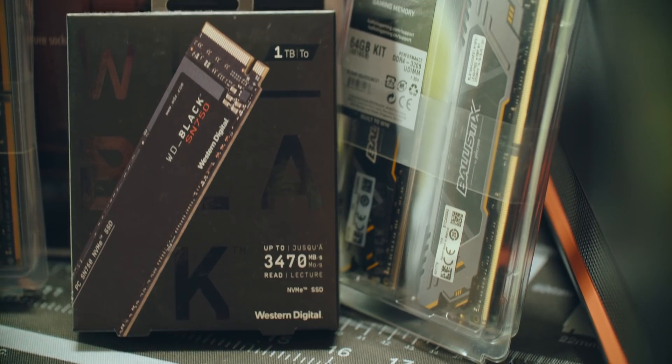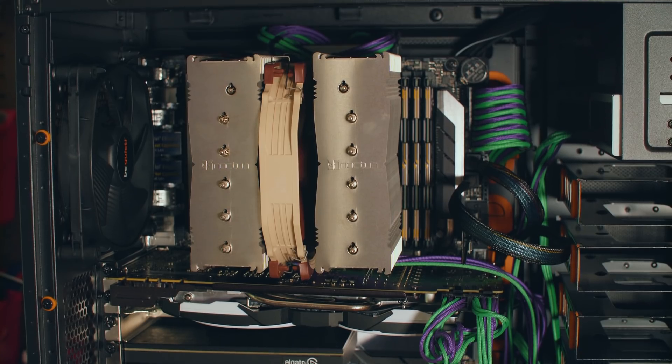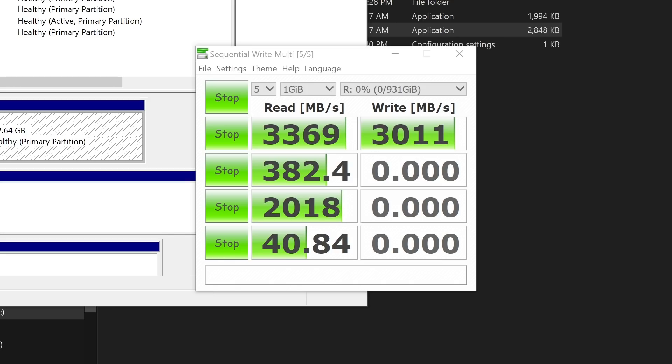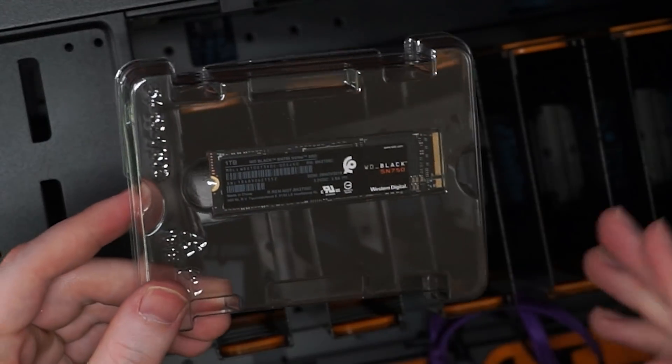Western Digital sent over one of their new WD Black NVMe M.2 SSDs — the SN750. It is blazing fast. I did a sponsored video for their original WD Black NVMe SSD a couple years ago, which is my main boot drive. The SN750 gets over three gigabytes per second read speeds and over two gigabytes per second write speeds, which is insane. It also has a nice clean black PCB, whereas their older one had a standard blue PCB. That memory kit looks pretty cool in the rig as well, and I do a lot of intense high-bitrate recordings straight to ProRes or Blackmagic's crazy one gigabyte per second data rates.